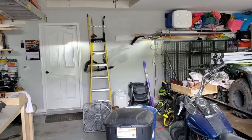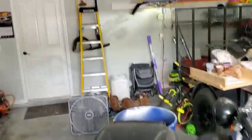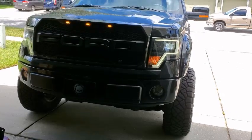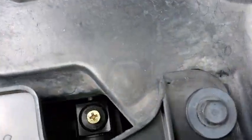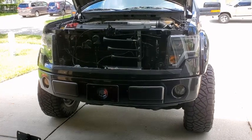It's still daytime so let me back up — there it is on the wall. The light bulbs are at nine and three so it's perfect. It's sitting high because my truck is obviously lifted and I've got some weight in the back end and my driveway is on a bit of an incline. Tonight I'm going to put it on flat ground and see how they look. Last thing — they are adjustable by the way, and fairly easy to do. You don't have to take off anything. The tab is actually located right behind the top mounting bracket of these lights, and it appears to be just a single Phillips head screwdriver. So right in that little hole there, they are adjustable. I'm going to play with the adjustments tonight, but overall I'm pumped about it. We'll see you guys at night.